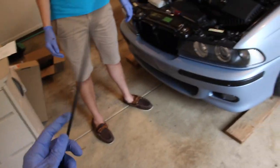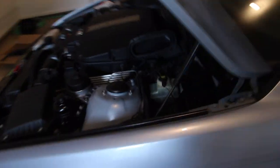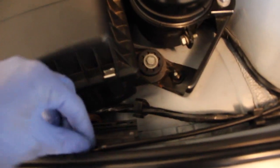Installation of the new cable is pretty easy. Take this end and shove it through the hole in the firewall; have somebody pull it through until you get to the grommet, then slow down so you don't break it. Stick it up through the hole from under the hood, have somebody pull it a little bit, and then from inside put your fingers right against the firewall and start pulling it through gently. You'll know when it's through far enough — there's a little step and it makes it through and then doesn't want to go back in. It took about 30 seconds.